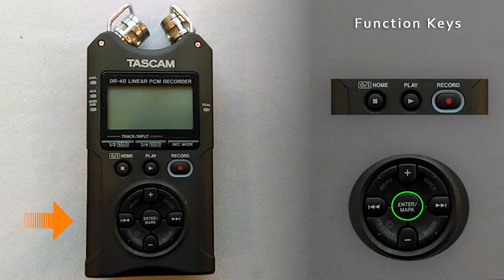The very center is the enter key — push this button to choose a selection. Menu on the top left will take us to the menu where we can explore different functions and features of the recorder. The quick key allows us to delete, divide, auto divide, level align, and mix down tracks. We will use this feature only to delete unwanted tracks.